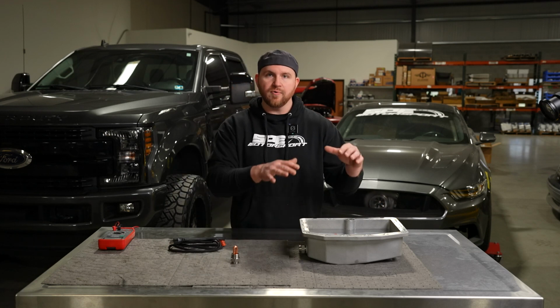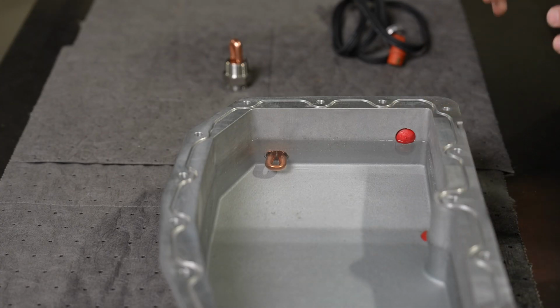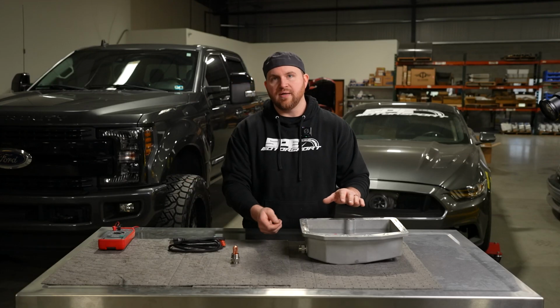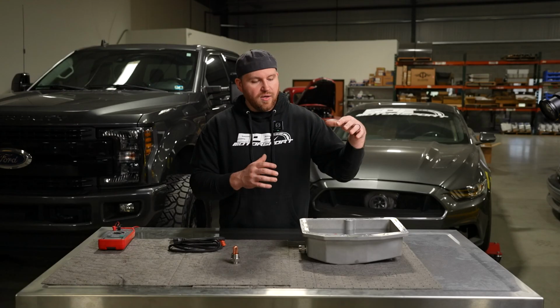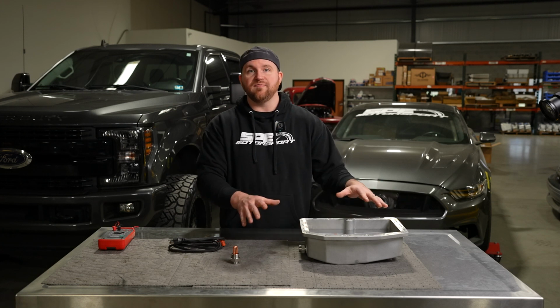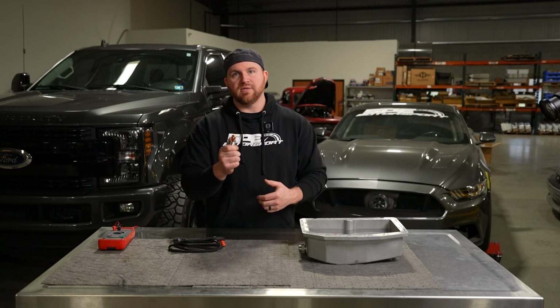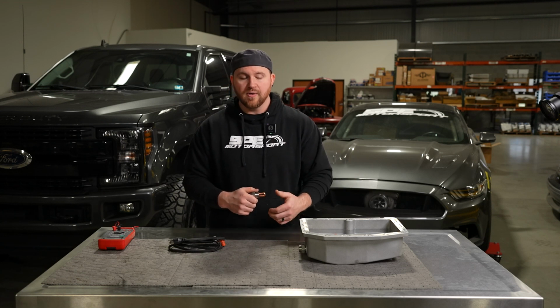In the oil system, all your oil is laying in the bottom of your pan. It's not being pumped through the engine when the truck's off. So if you plug the element in and leave it for a long, long time, being that the system is not connected to a radiator or anything like that that's functioning, it has no way to actually dissipate any excessive heat. So let's say it's 30 degrees outside and you're like, all right, I'm gonna come home from work and just plug this thing in right away. Problem is, that oil is going to over temp and the element is going to over temp as well because it's plugged in for so long. So this element won't be able to dissipate heat, and when it can't dissipate heat, it'll actually burn out.